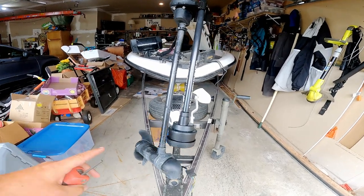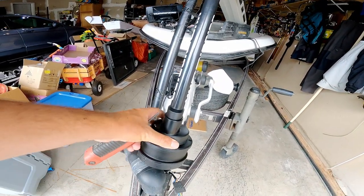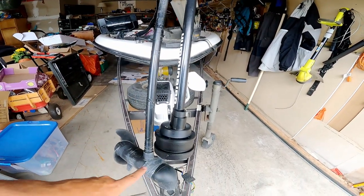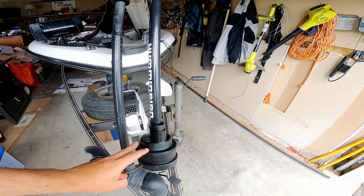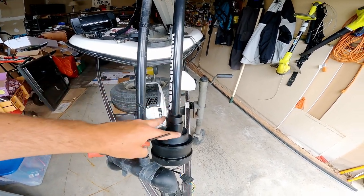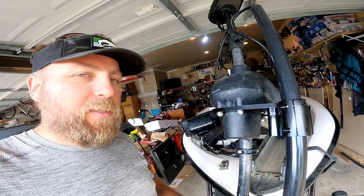Here in the garage we can get the alignment sorted. We want this rounded part - not the squared-off part - basically straight in line with the boat. I think that's pretty close but we'll fine-tune it once we get on the water. You've also got this height adjustment bracket for your trolling motor so you don't lift it too high and hit the prop, since this can move independently. I'll set it a little higher now and fine-tune it at the lake to find that sweet spot - deep enough to stay in the water while fishing but still able to run shallow. Hand-tighten it here and then lock it with these little set screws using a hex wrench.